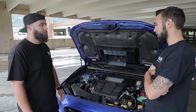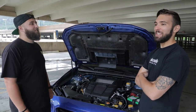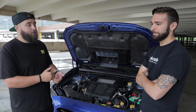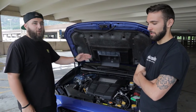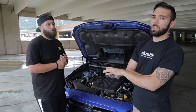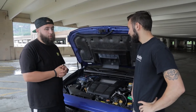Aftermarket intake - need a tune, yes. Aftermarket downpipe - need a tune, yes. Anything other than a cat-back or axle-back exhaust - just get a tune. If you're adding parts gradually, get an e-tune to carry you through, then at the very end when you're done building, go get a dyno pro tune and you're set. Make sure you have an access port, because that's what you need for tuning.